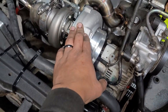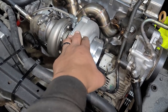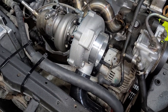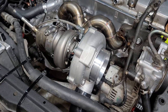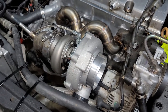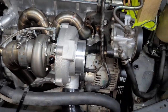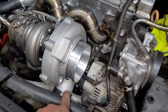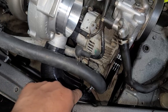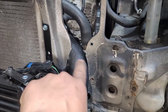This is kind of the first look at the turbo — I didn't really want to show you guys in this video but I kind of have to, to show how I'm routing the intercooler piping. This is a Garrett GT3076 — it's rated for about 570 horsepower or so. It's the dual ball bearing with the water-cooled setup. I got the turbo outlet going with a coupler adapter from two-inch to two-and-a-half, and that hole you saw me cut — I'll come back and clean that up.